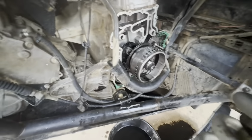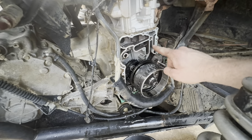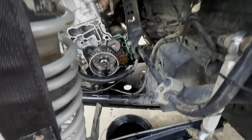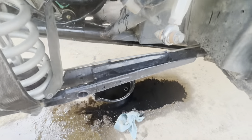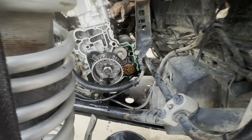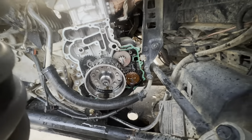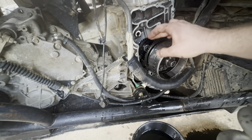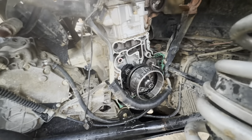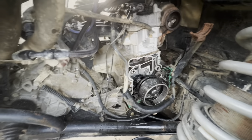Not too bad so far. You've got a whole bunch of bolts around the side and you do have to take your oil cooler off - you've got two bolts in behind it that you've got to get to. It's going to make a mess, so I'd probably do it somewhere where you can make a mess or go ahead and throw some oil dry down. Probably give all the gears inside a good looking. This thing's got 6,000 miles on it and it's all stock gears - so far they don't look too bad. Give that a good checking out and start getting everything cleaned back up for the new side cover.